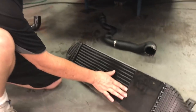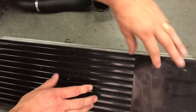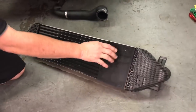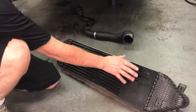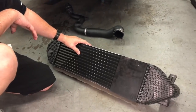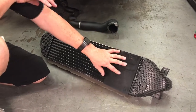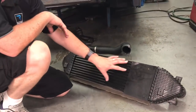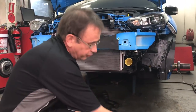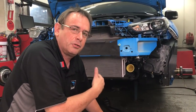One really interesting thing I've been investigating recently: you might be wondering what is this piece of plastic on the front of the factory fitted intercooler. This part here — if you can see it — it's actually just glued in place, and it is actually a blanking plate. For all intents and purposes, it was fitted by Ford when they did the final production testing of the car before they released it. What it does is reduce the efficiency of the intercooler on the hot side, effectively making the intercooler smaller.